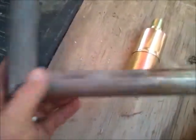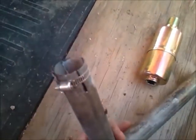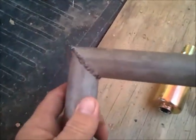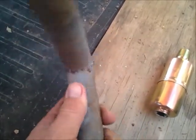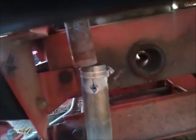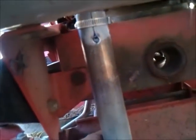Just some galvanized fence piping is all it is. Cut it to length with a miter, done a little bit more welding — it's kind of ugly, but it's going to serve the purpose. The way it works is, if you can see that slip on the original pipe coming down, that goes into that muffler hole right there.